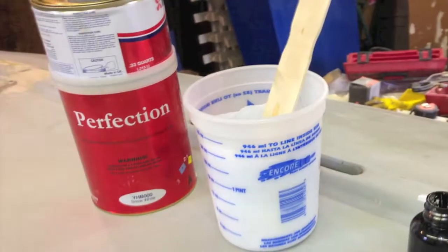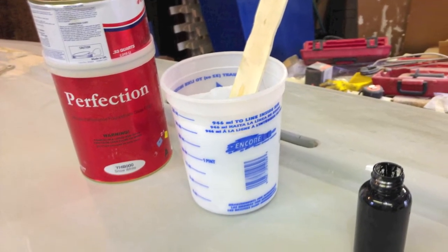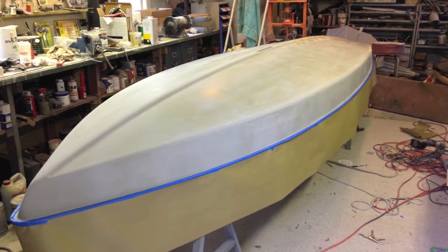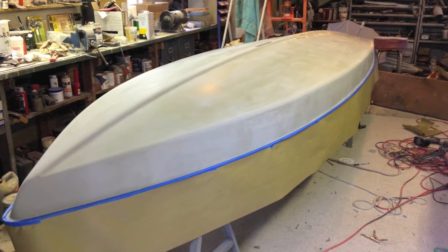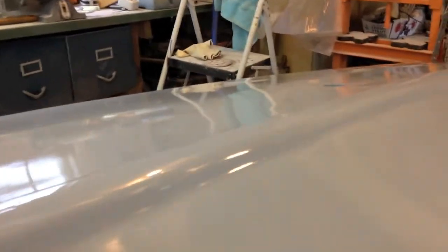Sanded down a little bit more — the whole hull is sanded and ready to paint. The side piece I added some cloth to the same way as on the bottom, and that's nice and structurally sound now. The paint we're going to use is Interlux Perfection. Got a little bit of black from the local hardware store, taped the sides of the boat, ready to spray. The gray looked nice; it matched the original color, and here it is after the spray job — turned out pretty nice.